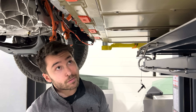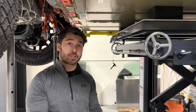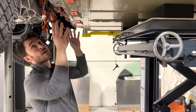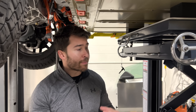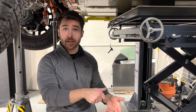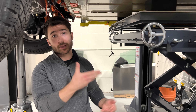One other thing to factor in from a high voltage perspective is the charge cable. Tesla uses rigid aluminum cables to go from the charge port on the side of the vehicle to the battery pack. Normally we can access that under the second row seat at the penthouse, but because this has a slightly different architecture with the penthouse right here, we had to go in through the bed of the vehicle, remove a panel, and fish our way in. The tonneau cover roller mechanism required us to snake past it and rotate at a couple different angles to access all the proper connectors. Once those were disengaged, all the battery connections were loosened and it was simply the structural elements anchoring this pack to the vehicle.